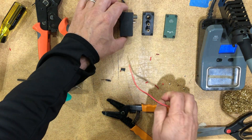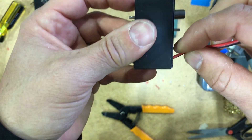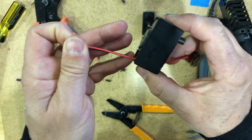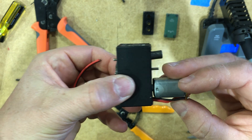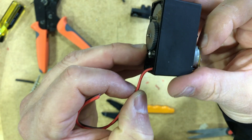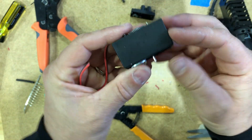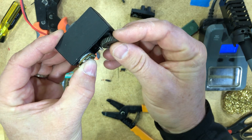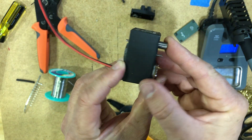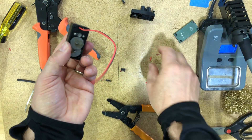The next thing we're going to do is reassemble our motor. We're going to start by threading the wire back up through the hole it came from. Now this new wire is not going to fit back into the rubber housing. When you're putting this back in, the gear has to fit up in there — we want the wire to be not too loose inside, and it's going to fit just about like that. If a gear does fall out on you, the best thing to have done would be to take a picture of both sides first. I didn't do that because I've done this quite a bit, but taking a picture first would guarantee that you remember where everything is supposed to be.